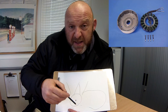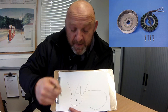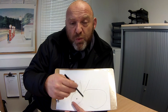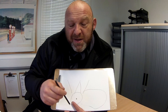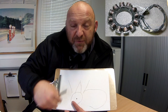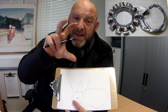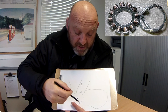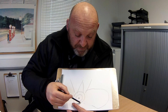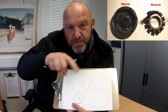The stator is a fixed winding of copper wiring around lots of poles, or in a circumference around the crankshaft area. Now that will actually induce an alternating current, but not by itself — you have to induce a current in it, create a current in it, and it's done that by the rotor. The rotor is actually fixed on the end of the crankshaft, and in this case it's a cap-like rotor. In other words, it actually travels and rotates around the outside of the stator, so there's the stator in the centre and the rotor cap is on the outside of it, and it spins around it.